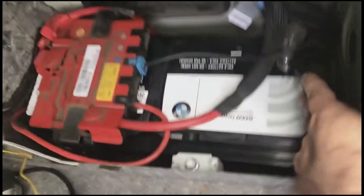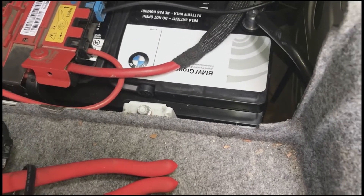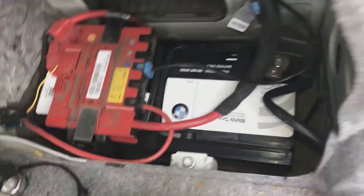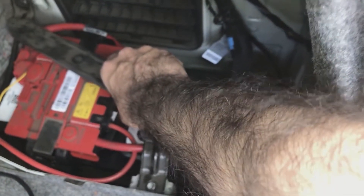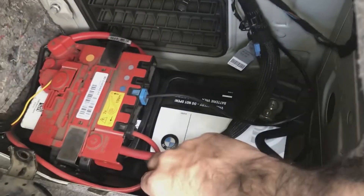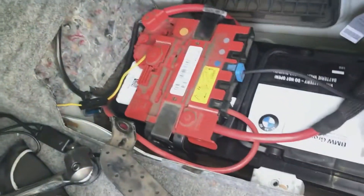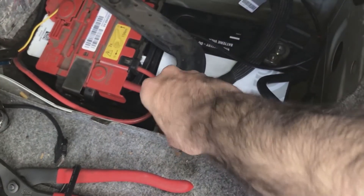The negative one goes here on that side, and then after that we're all done with the battery installation. All I've got to do now is tighten some screws. There is also a battery hold-down bracket — this thing goes essentially right over the battery and prevents the battery from moving around when you're driving. It's secured by 10 millimeter bolts right there. I always put bolts right back in their original holes so I don't lose them. Put the bolts back on, tighten, and then the battery's done.